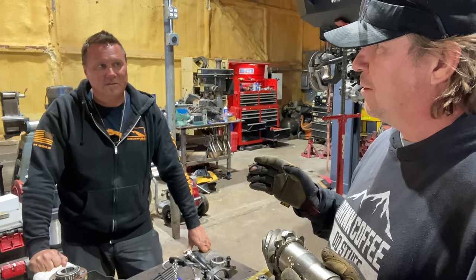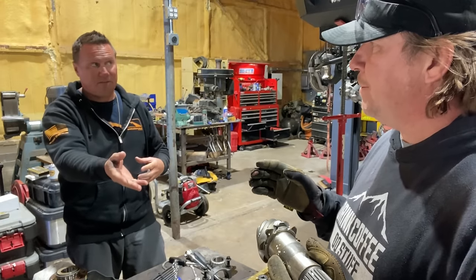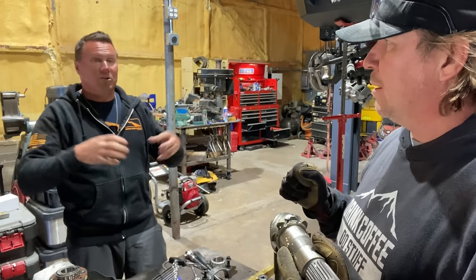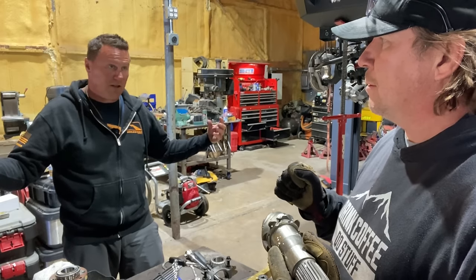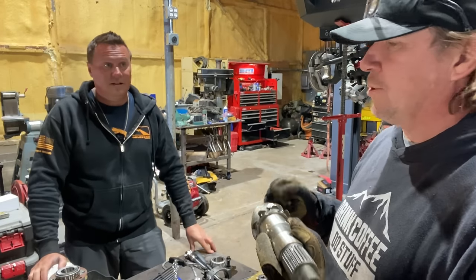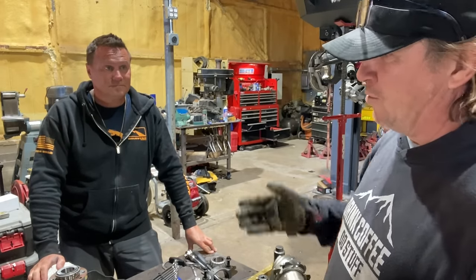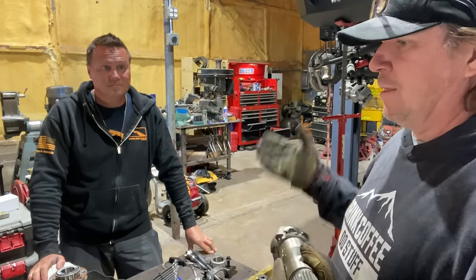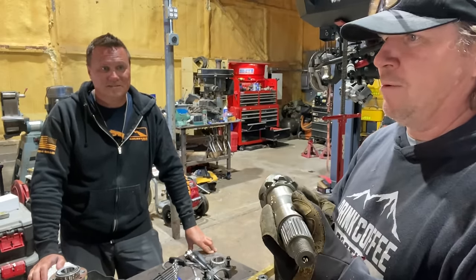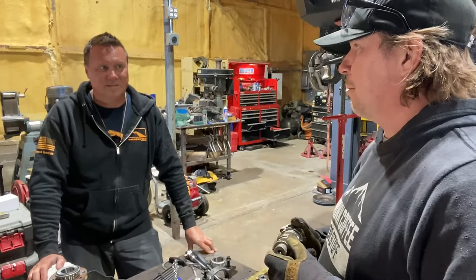It'd be like using a portal box on the end of an axle, if you're familiar with that. That means there's gearing in the differential, but usually very high. So it'd be like a 3-to-1 instead of a 4.88-to-1. Yep. And then you put your gearing out here, which relieves a lot of the stress on everything before those portal boxes. So it relieves the stress on all the drive line, the axle shafts, the ring and pinion. So part of the reason you want to do this is because you're going to bigger tires, which take more torque to get moving. So when you torque multiply it, the engine is like, hey, I'm still working the same way I always worked. But the ring gear's like, oh, I'm doing the work for you because I'm multiplying your torque so that we can turn these bigger tires. Yeah, I like that.